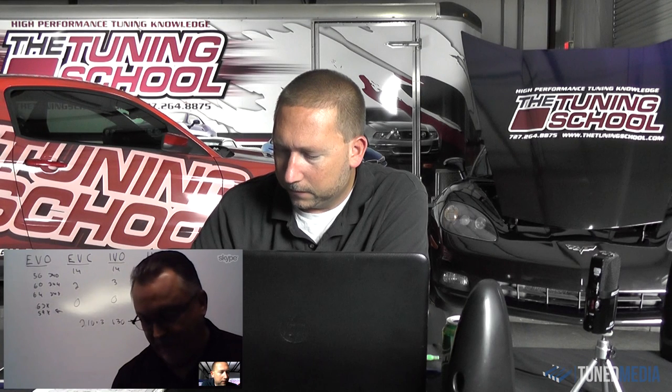Because here's the next thing. When you apply that to the exhaust valve, if you say, okay, I have a 1600 exhaust valve, what's that, 0.3 number? It's 480. Wow. Exactly. That would freak out a lot of customers. Yes. And you would be amazed how much power an engine will make with a very low lift exhaust valve in it. We've made 2 horsepower per cubic inch naturally aspirated with 500 exhaust lift. Wow, that tells you how critical that is.